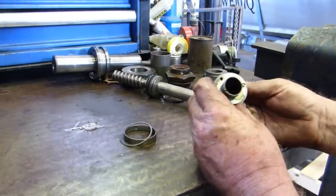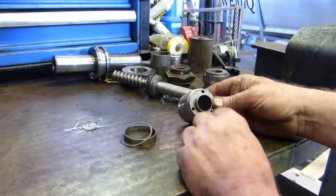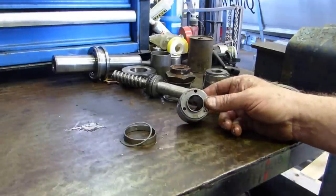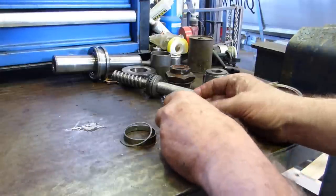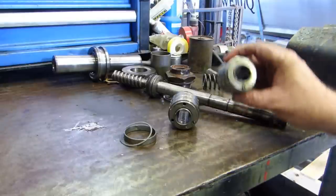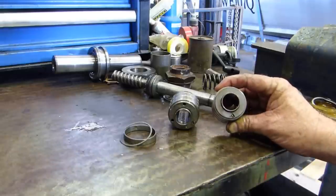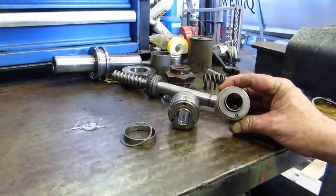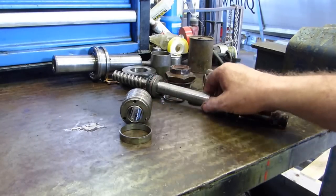With this one, you'll notice some extra holes - these two holes here are return holes. That's how the oil gets back into the top of your gearbox. So this one with the two holes goes towards the threaded end on the bar. This one with no holes apart from the valve hole is the top one. That's the bottom one - don't mix them up. I did a steering up once and it didn't matter what I did, it kept pouring oil out the top nut. That's what had happened - when I was learning to do them, I got them mixed up. It was a lesson I never forgot.